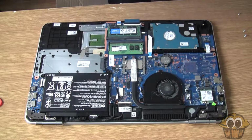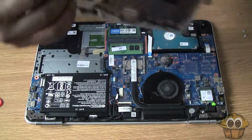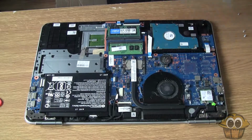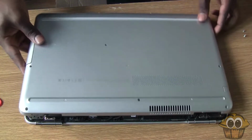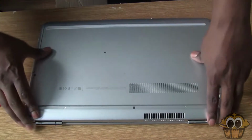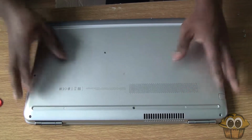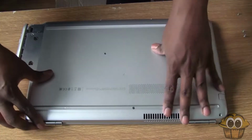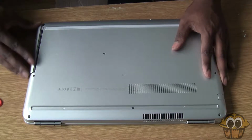And if you ever are taking out the back of your laptop, it never hurts to quickly shoot that with a bit of compressed air. But that's the caddy inserted. A little tip would be to pull the caddy out a bit, so not have it fully in there, because if you have it fully in there, it's not going to click into where it needs to get to. So as you see, I'm making a mistake right here, but what I do is I pull out the caddy a little, place it down, and then it will just go into the SATA port.